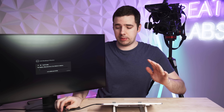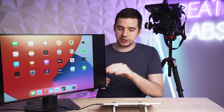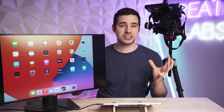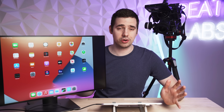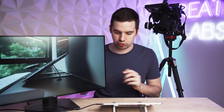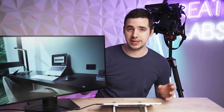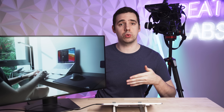That's enough for drive speed. What about other accessories such as an external monitor? Let me grab a 27 inch 4K monitor and see if it works with the Thunderbolt dock. So here we have the monitor — just a quick note, this is actually the third cable I've had to try. I tried USB-C to USB-C, I tried DisplayPort to USB-C, and none of it worked. I had to go hunting for a DisplayPort to DisplayPort cable, and only then would it work. So as you can see, it's working totally fine. If I open up LumaFusion, loading up fine — streaming full size and playing in real time, it's working perfectly. The actual quality is good too, so no real issues there.